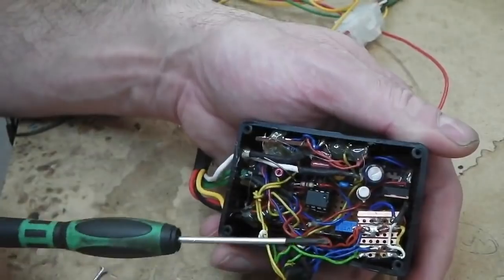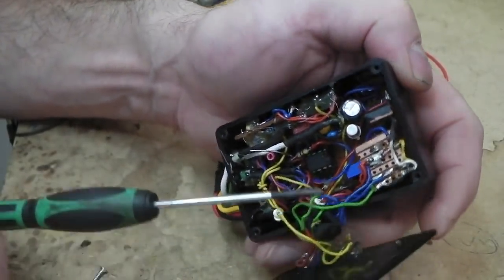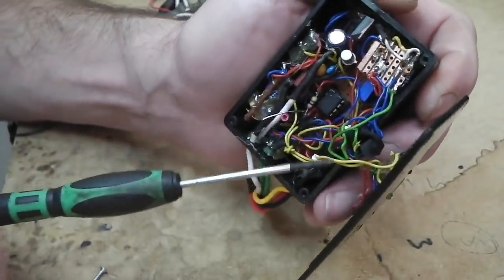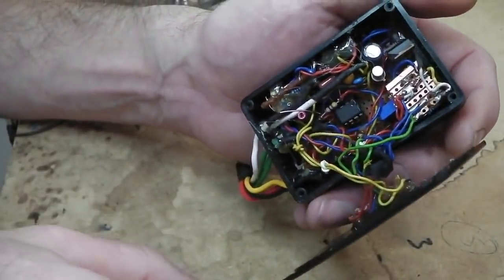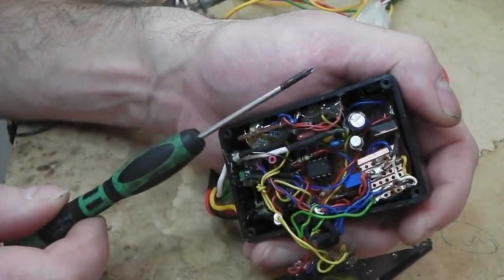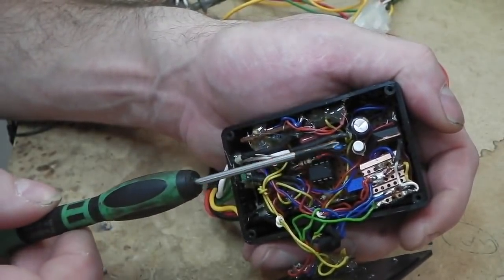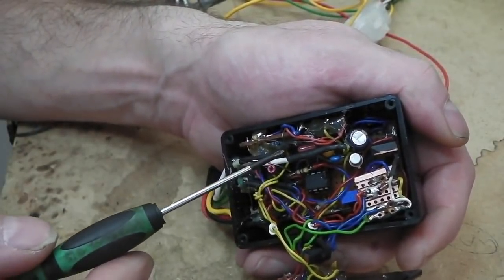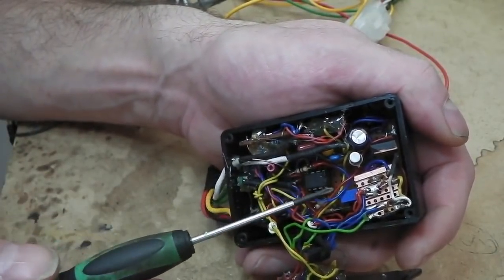That's something aside. It's all crammed in. There's not a lot of room. Look, I've run out of space. It fits, it works. If you wanted to, you can pour a resin in here and seal the whole lot as a sealed box. It's called epoxy potting compound. It's like black, sometimes it's in white, and it's totally inert, and it's used for sealing stuff from the environment.